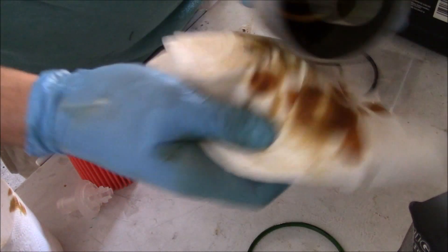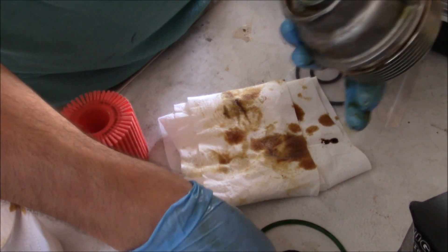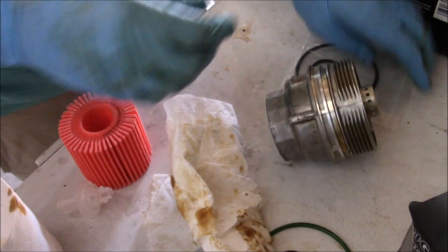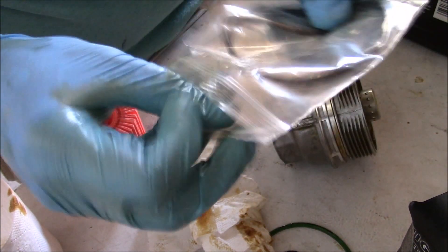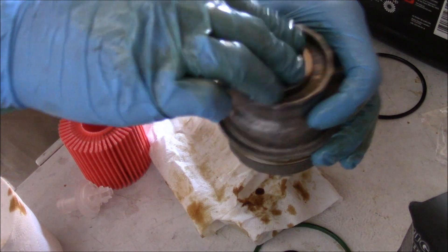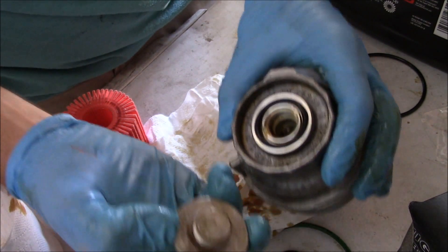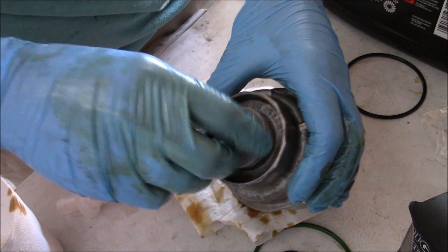Got it by hand — all right, cool. The old o-rings are still really pliable and didn't really need changing, but we have new ones so we're gonna coat the new ones with a little bit of fresh oil. This is a magnetic drain plug — you have to clean it every time you change the oil, otherwise dirt and debris are gonna stay there and it won't filter as well. Be sure to clean that.